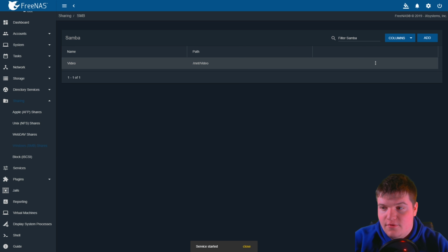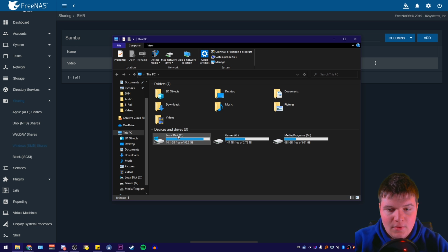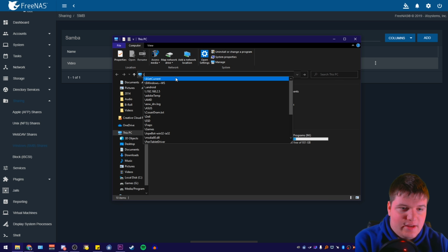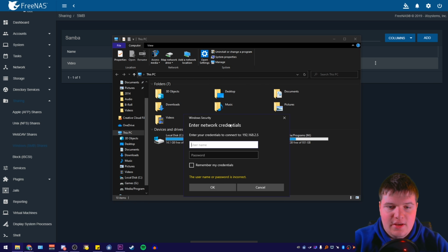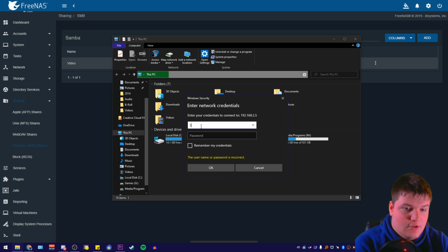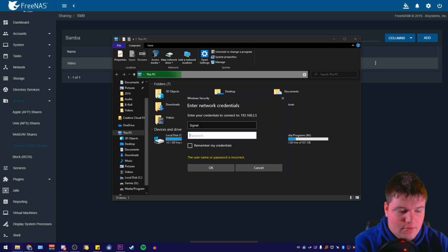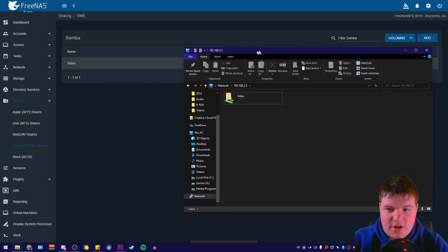So as you can see, we have our video share here. Now, in theory, I can open up File Explorer. I'm going to bring it over here. I can type in // and the IP of my computer. I've already typed it in, so it's there. It's going to ask me for my credentials, so I'm going to sign in using that user I created. I made the username signal and made a password. I'm going to have it remember them. If I hit connect, there we go. We see the video share right there.